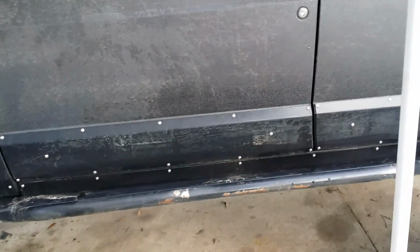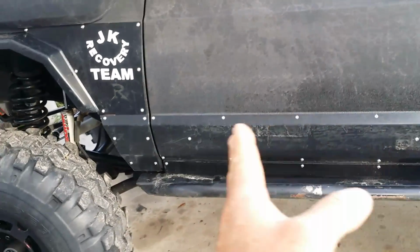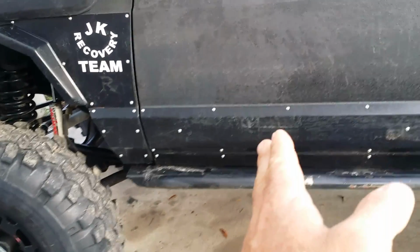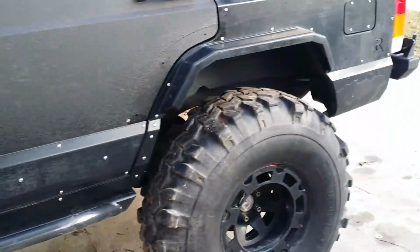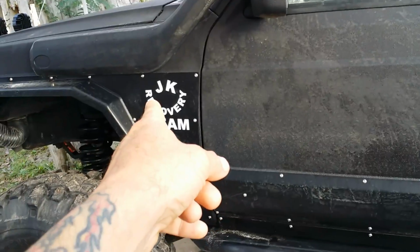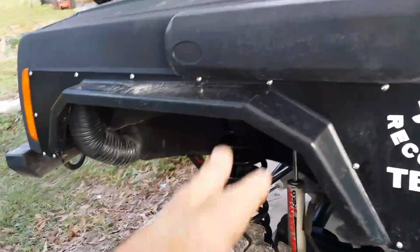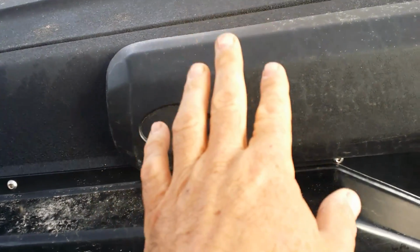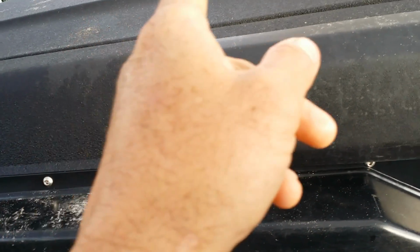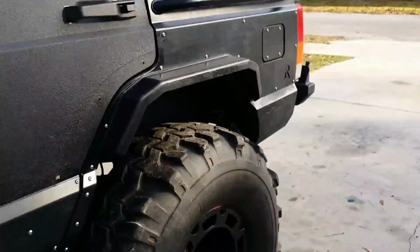I want to get a little bit more than that. When I did the calculations on that website, I knew exactly where my Jeep ran at in RPM range, but I wasn't taking account for spinning all 4 tires. So that's extra load on the engine. But they sell an aluminum head for that engine, and I know people say that it won't really make that much of a difference, but it will. Put maybe an aluminum head, bigger throttle body, 24-pound injectors, change the camshaft, and see if it gives a little extra oomph.